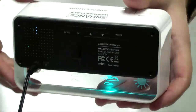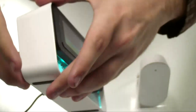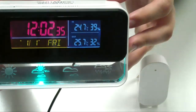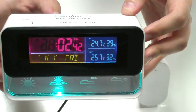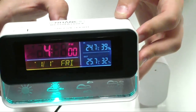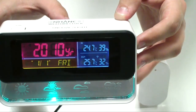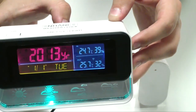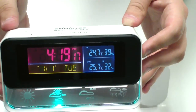To set the time, we do have buttons on the back. You have a mode, set, and then an up and down button. Press the set button to enter time mode, and use the up and down arrows to select your time. Press set one more time to move on to minutes. Use your arrows up or down to adjust the time, and then press set again once you're done. Then you can set your date as well — the month and the day on the bottom — again using your up and down arrows. And then once you're done, your time will get going.